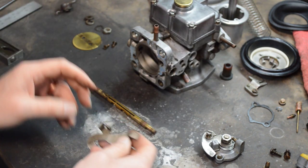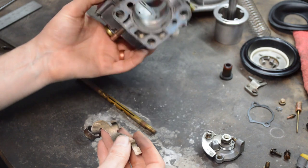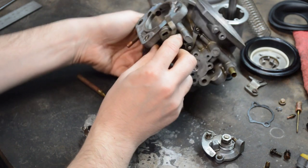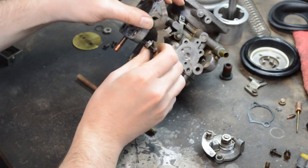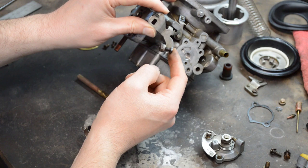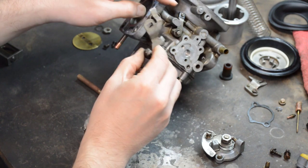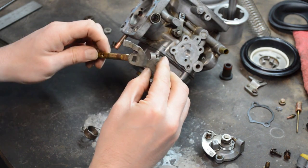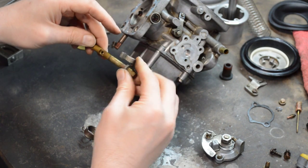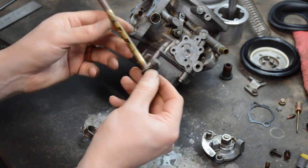Here are the various pieces to the throttle — we can get this half reassembled first before we start. The throttle is going to be spinning this way. Here's where the adjustment screw will be. This goes against the starter box, so keep the same orientation — it stops when that part hits. In terms of the actual throttle shaft, you want the indent so that the screws go on the outside.